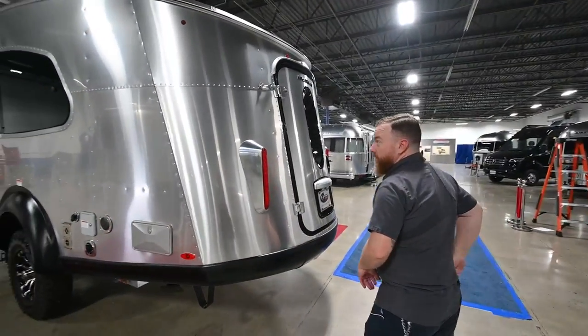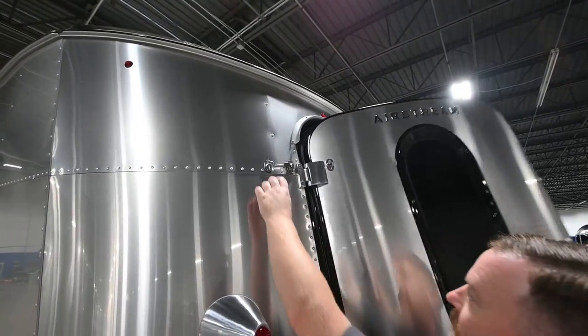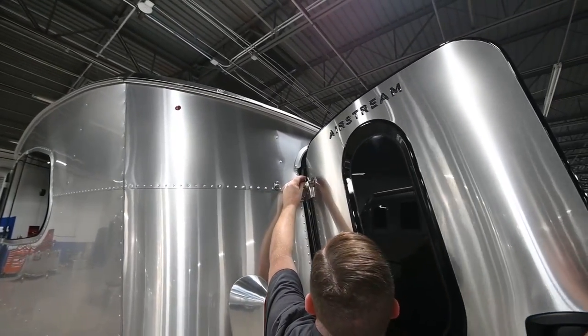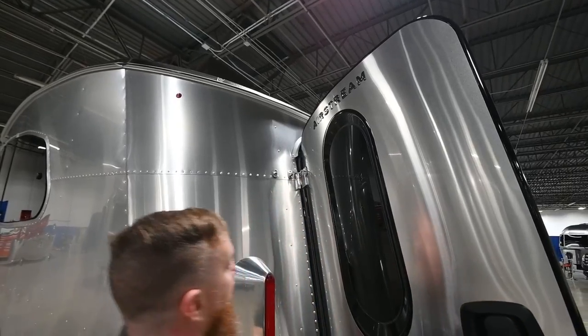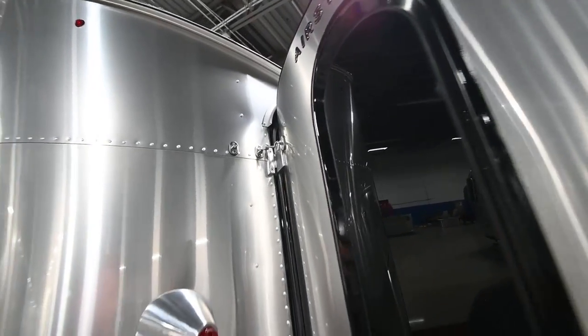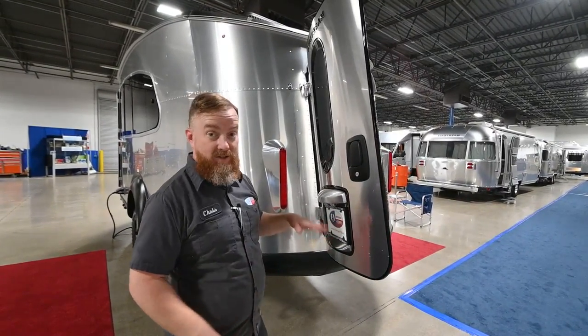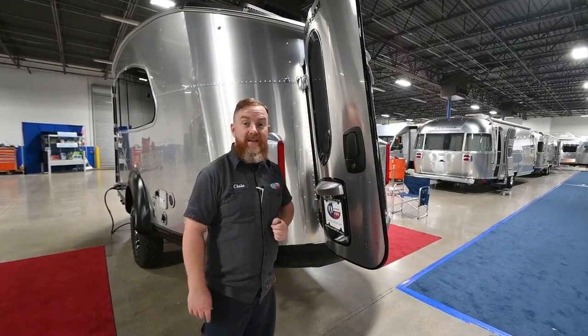On the rear door, there's a little hook here. This door is designed to be rested against this hook, just like so. You don't want it setting on the hinges themselves. You want to make sure you don't go slamming the door. If that hook is attached and you slam the door too hard, you might yank that out of the door.